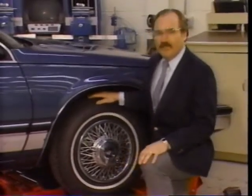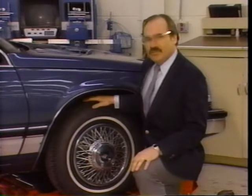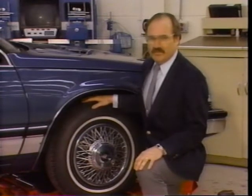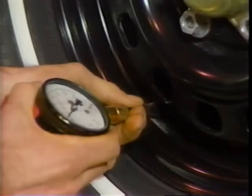If a car has a chronic case of irregular tire wear, it's a good idea to check the rotation history of the tires. If they haven't been properly rotated at the scheduled intervals, there's a good possibility that's the cause. If they have been rotated, chances are the toe angles on the non-driven wheels are incorrect. Excessive toe angles on non-driven wheels cause irregular tire wear, while excessive toe angles on driven wheels cause regular but premature tire wear. One common misconception is that irregular tire wear is caused by wheel imbalance, wheel runout, or faulty shock absorbers — that's just not true. The three service areas that can cause irregular wear are improper inflation pressure, lack of rotation using the modified X method, and misalignment — specifically toe.